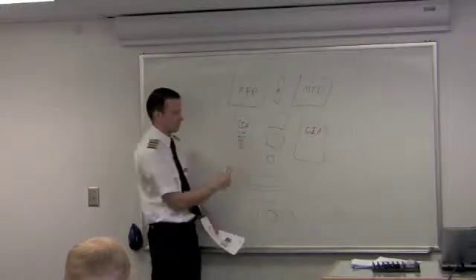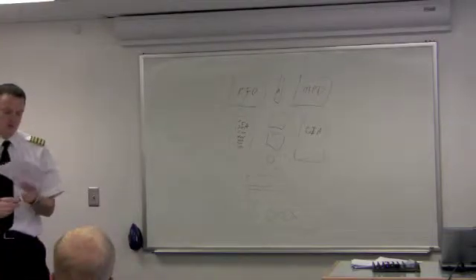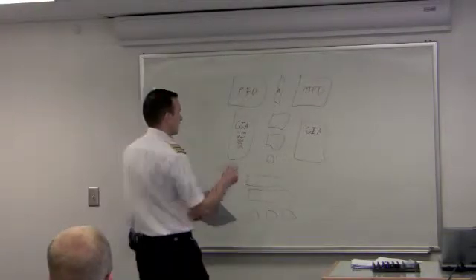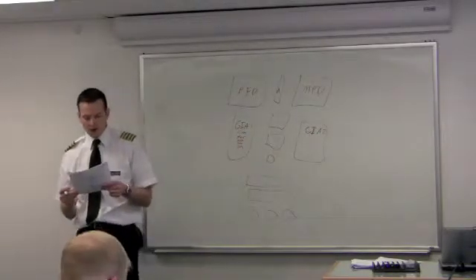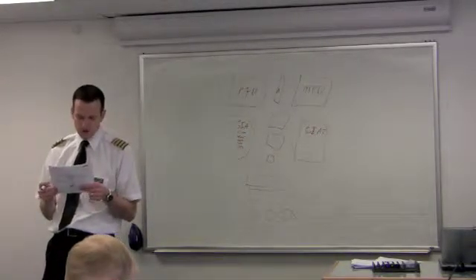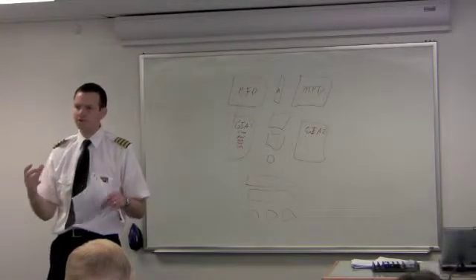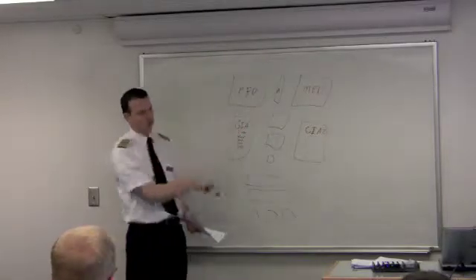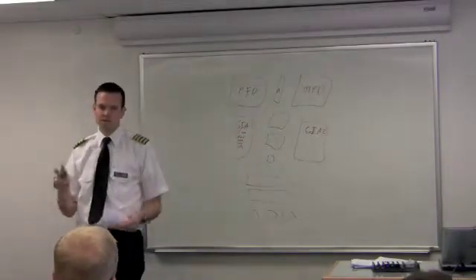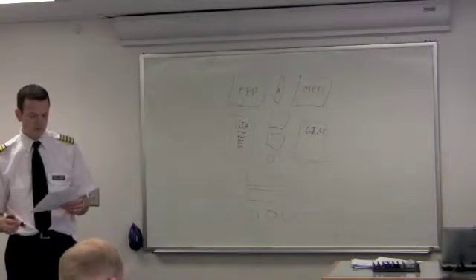The GIA is a central unit that has all of my comms and navs in it — Localizer, GPS, DME if installed. I've got a 1 and a 2. They also contain IO processors. The GIAs are kind of the processing unit of the G1000 — information goes through them and back out through them. Think of them as the intel of the system that's sending everything around.